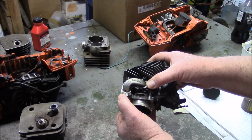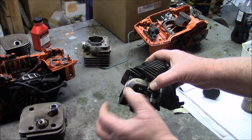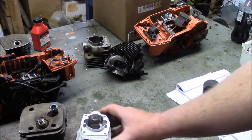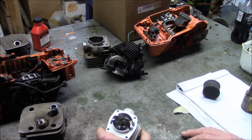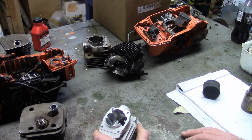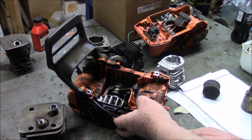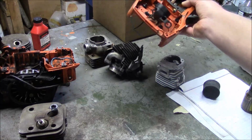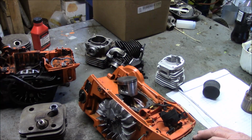Much easier to do. Requires a little bit less manufacturing technology to achieve the same shape from part to part with this cap technology versus a cast-in core. But these are still easier. So when a design engineer thinks about a very simple and a very reliable saw, why not? It works. If you need more cross-sectional area for more power, just add another groove. The old Homelites did that for years. And that, along with a one-piece case like this, you've yet again reduced a lot of manufacturing variables as compared to something like this, where now you have to worry about the flatness of that mating surface and all kinds of things.